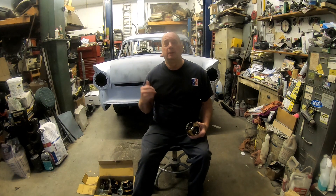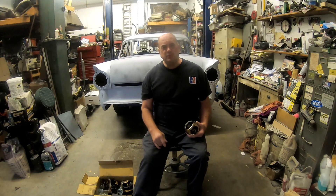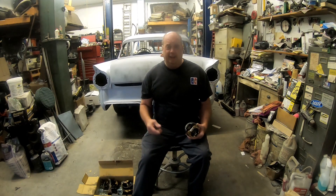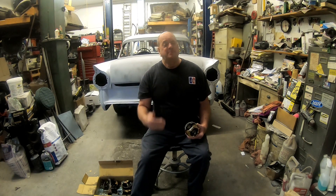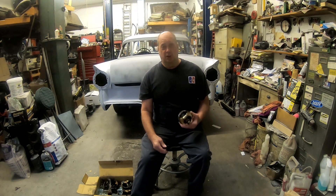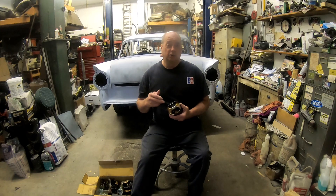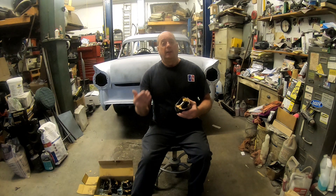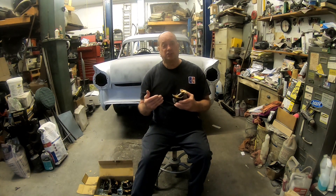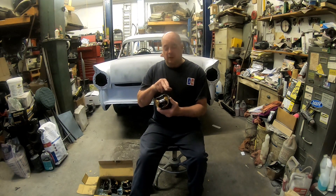What we've got is a Jeep 4.0, a 2003 Jeep Grand Cherokee — it's my son's vehicle. I'm not going to show you the vehicle or the full process, as there are many videos showing the ins and outs of replacing the pistons. I did have an interesting method for how I press my pins — I use a mini ductor on the rod as a rod heater, and I set up a fixture out of wood to hold the piston and a screw to set the pin depth so you can center the pin.